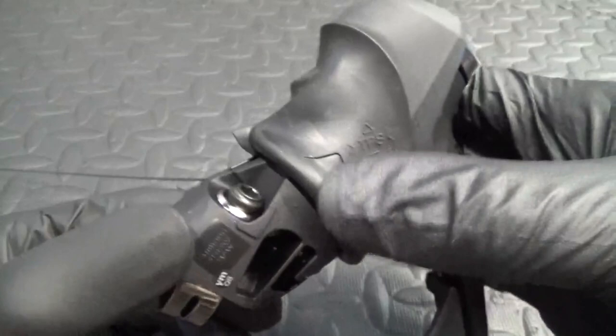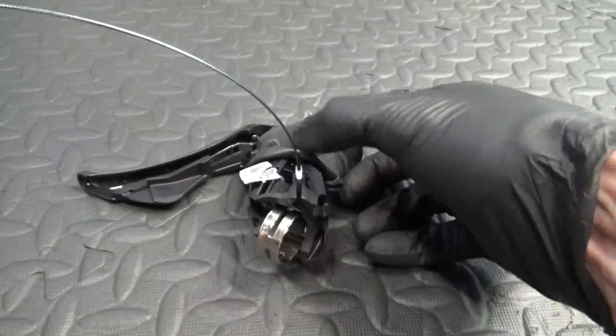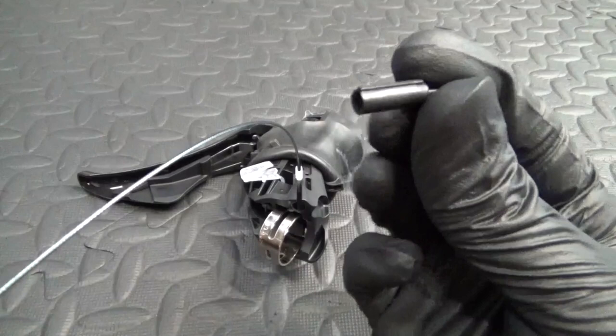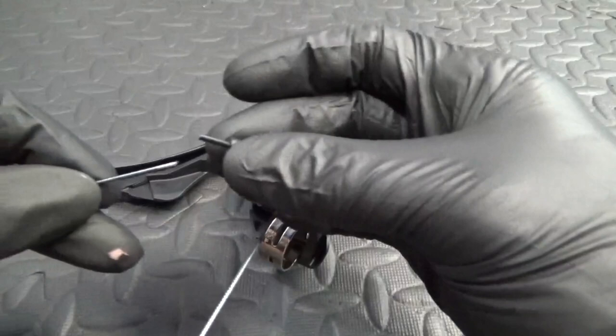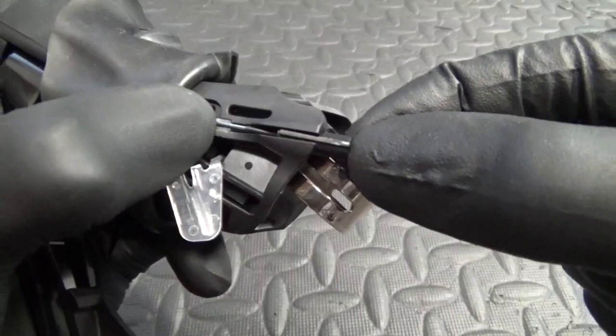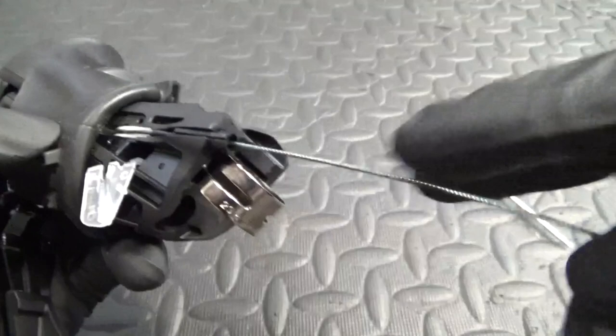Make sure it has gone up inside — if it hasn't, you may get bad shifting. Then on the inside of the lever, find the end of your cable. Get the cable end ferrule with the raised slot — the bump on it — thread that onto the end of your cable and thread it all the way around. The raised piece slots into the groove, and then your outer cable will come along and go up inside there, going round underneath your bar tape on your handlebars.